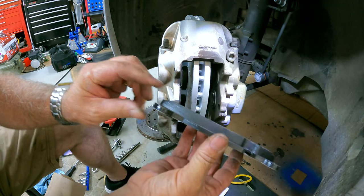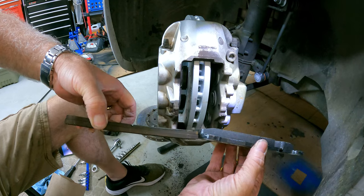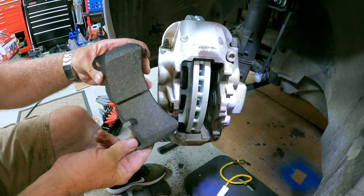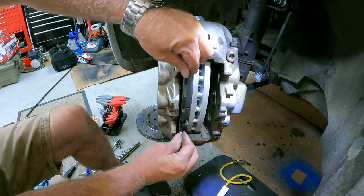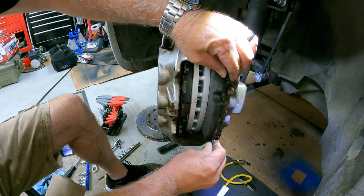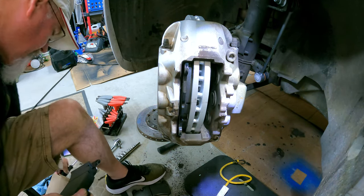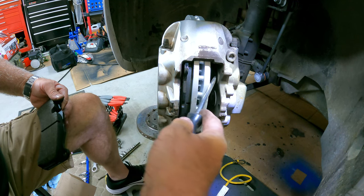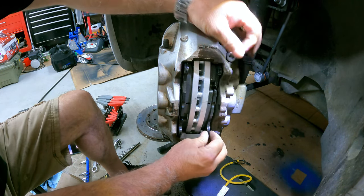I'm pushing against the metal ring that's inside the piston, and very gently against that because I don't want to get any sharp edges or points — I don't want to nick the rotor. Just want to do it nice and clean. That's the new one and that's the old one in a side-by-side — that one is worn pretty good. What you want to make sure when you put them back in is that if your pad has clips it clips into the big side, put them in the right spots. We're up against something so don't force it — what that means is one of these cups is just a little bit out. Just ever so gently convince them to go where we'd like them to be, and just like that, in goes the pad.